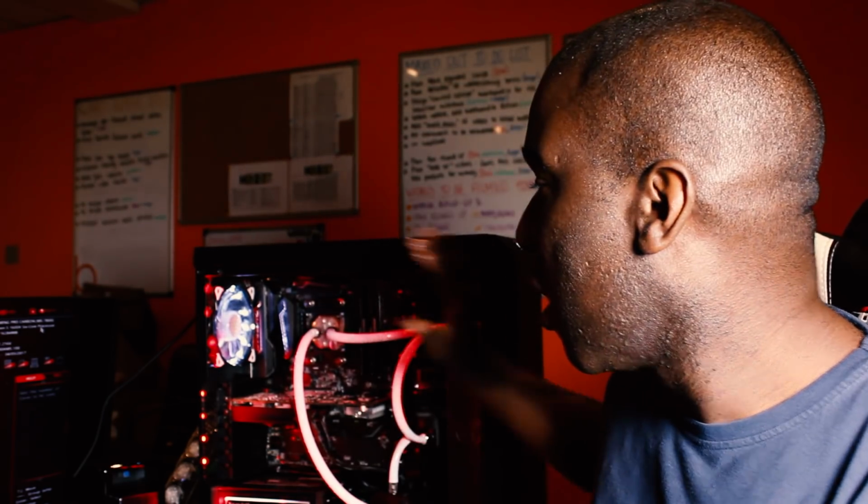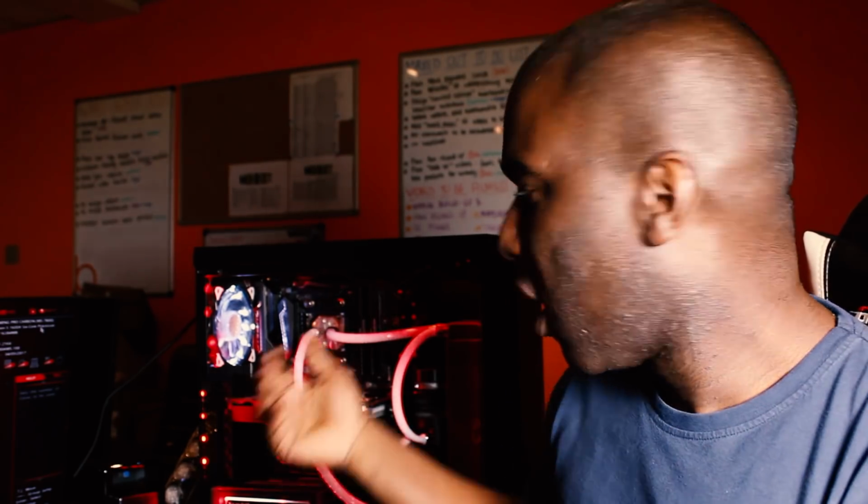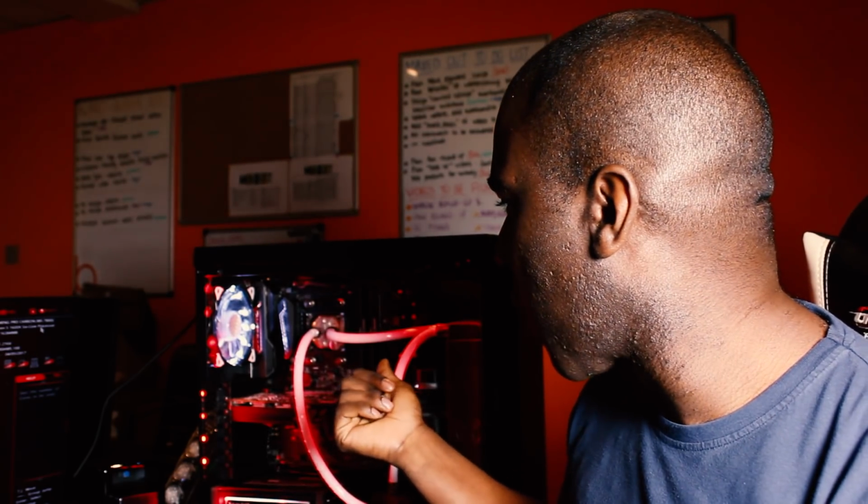I'm so shocked. But this system, yeah, it smashed it. It really did. I like to obviously overclock on a stronger, more stable motherboard, but I can't really say that this is not. This is a really, really decent motherboard for the price. I can't even believe that you can overclock on it like that. There was no offset voltage as well for the CPU to add more voltage. It could just overclock as a normal X370 motherboard.